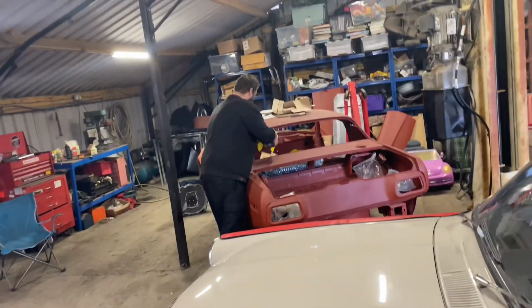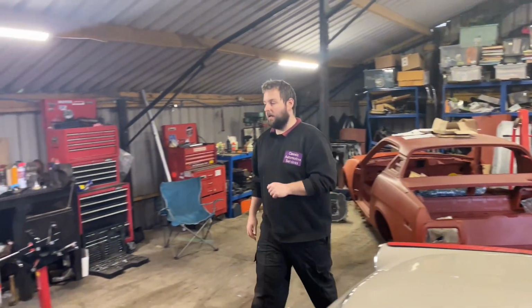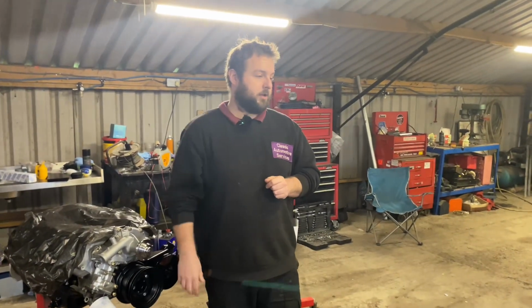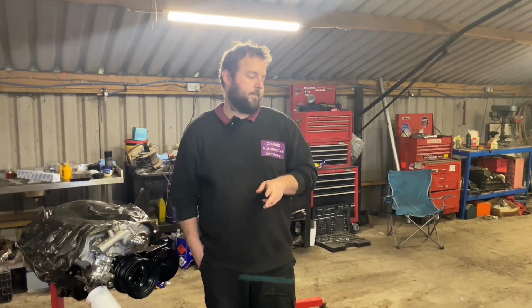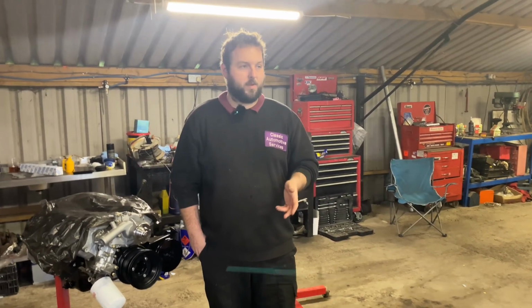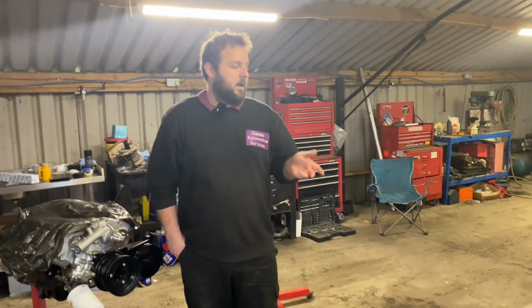That's pretty much all we have on the TR8 this week, as we've been doing the Cortina engine. We got the engine apart. As we showed last week, all we had was the head off it, and the bores were in one hell of a state. We measured it up, and it's already on +20s, and it wasn't going to clean up at +40. That's how much wear they had in them. It was horrific. I'm surprised it actually ran.